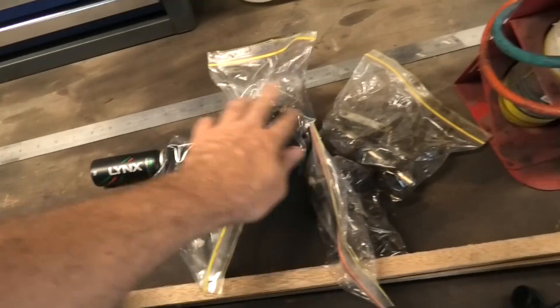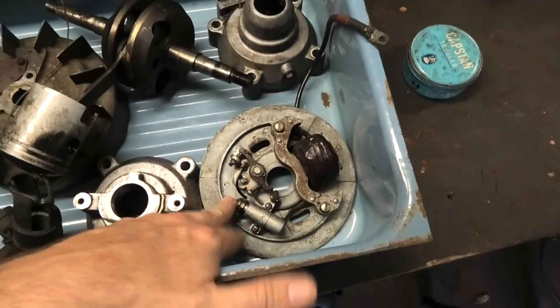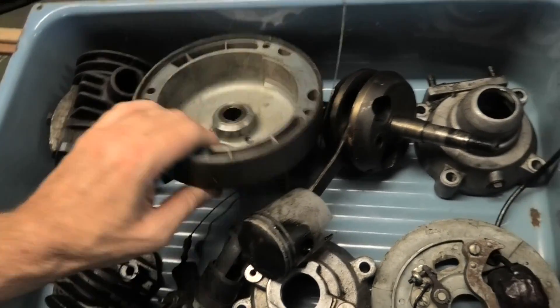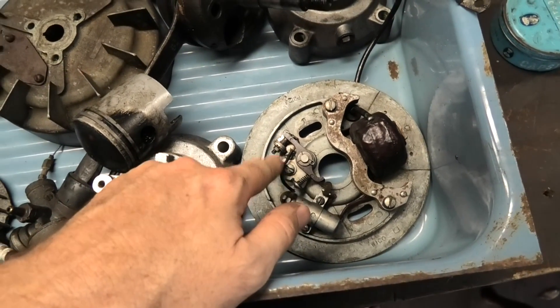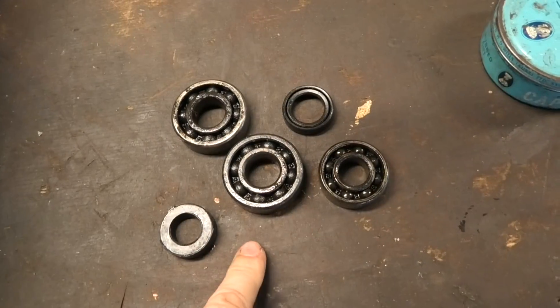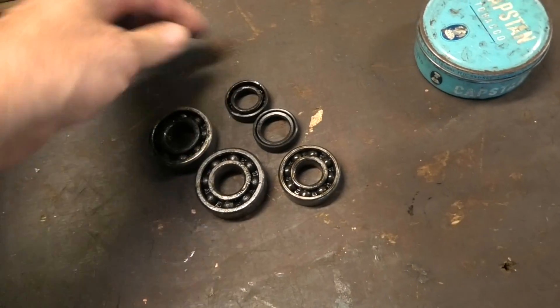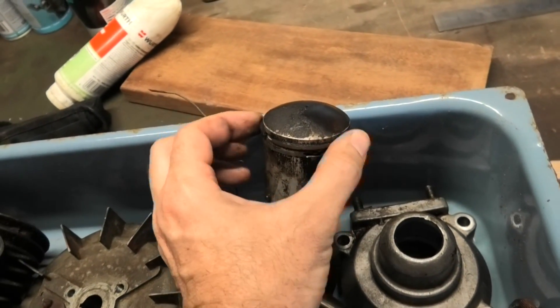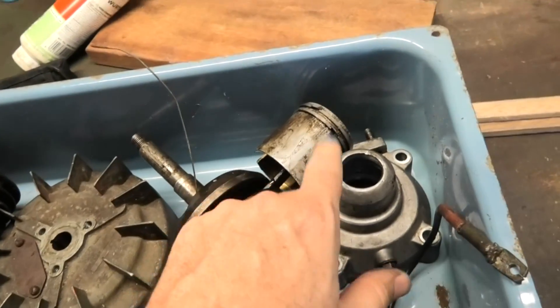I've got parts in ziplock bags sort of everywhere, and here are our main sections: two half square crankcase, the base plate with the ignition timing gear, our flywheel, the bore, and the head. Looks like this flywheel was drilled out here to balance it, and it's got a little cover on here which I presume is for accessing the points to do adjustments without taking the flywheel off. Here are all the bearings that came out — two large bearings, one small, and two oil seals. So we've got top and bottom oil seals and three bearings I'm going to replace now they're off. The bore looks pretty good, but I might as well put some new rings on this piston. I'll clean the grooves up but I don't see any need to replace it — I'll just put new rings in it.